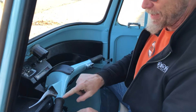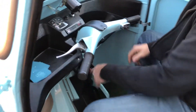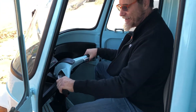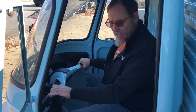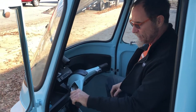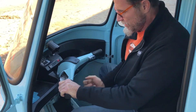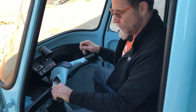So now we've stopped. I've gone ahead and put the vehicle in neutral — that's the spot between first and second. I'm going to engage reverse now by pushing that lever all the way down. Same thing: go to second gear and let the clutch out slowly. Be careful of what's behind you, and as you let the clutch out it will back up just like it's supposed to. It's better to engage reverse when the vehicle's in neutral and has some play so that the gears don't clash.